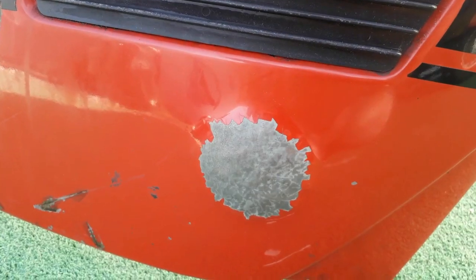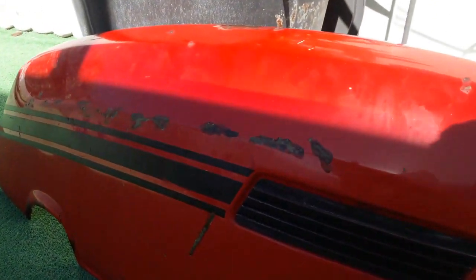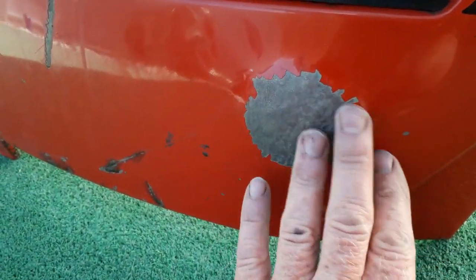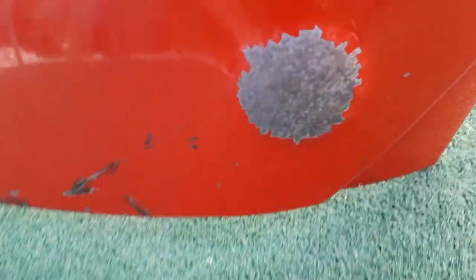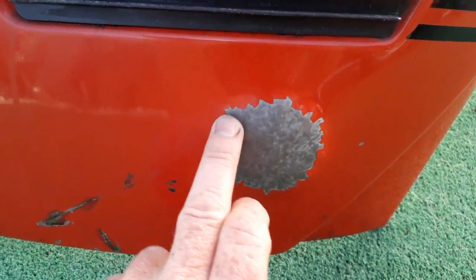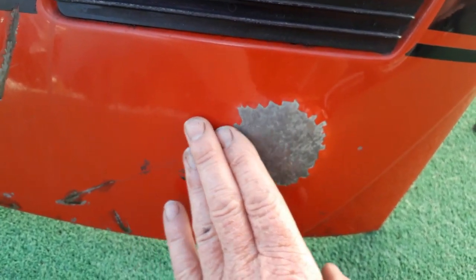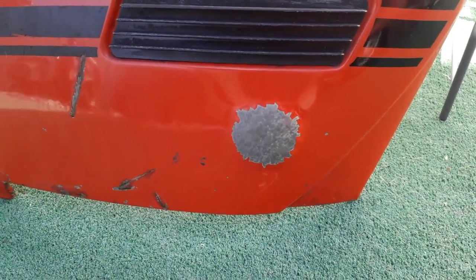The first thing I've done is viciously attacked my side panel. I'm not too worried about the paintwork because it's scratched to hell and needs repainting anyway. I've domed the side panel with a hammer — put a little dome in there so it doesn't squash the inlet rubber so much. Once I repaint the side panel it'll look nice; you'll just see a little bulge for the air filter.